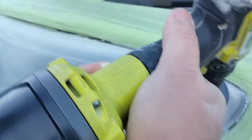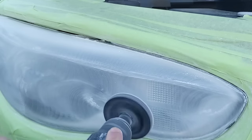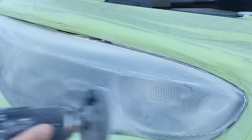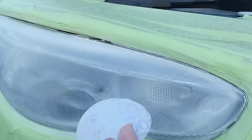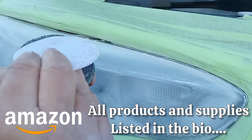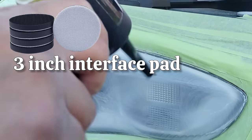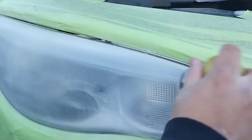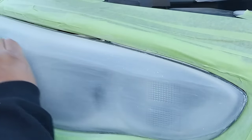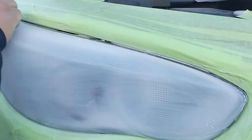So we didn't have to do much by way of removing the clear coat, which is typically the hard part. Any headlight is typically softer than the clear coat that is put on there, by rule of thumb. Right now I'm just removing a little bit of the surface of the polycarbonate — the actual surface of the headlight. There's essentially 0.01% of clear coat left, which is pretty much none, so I just had to resurface the polycarbonate. All that takes is a P800.